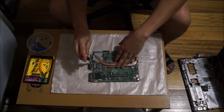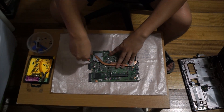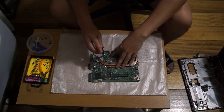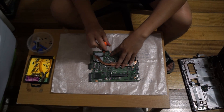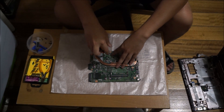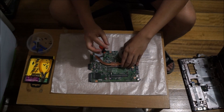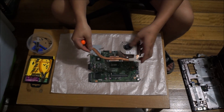There are numbers next to each screw hole telling you which screw to put in first. Don't be cheap on thermal paste — it's really important and it doesn't cost much. It's basically $10 per tube, and one tube can be used about 15 times.